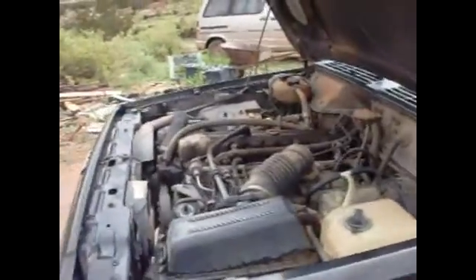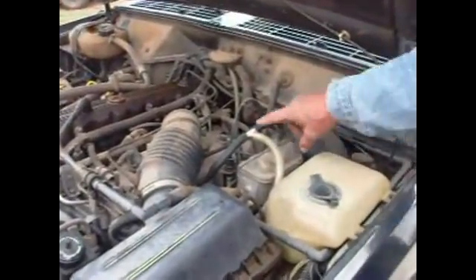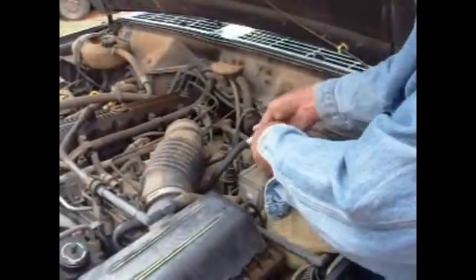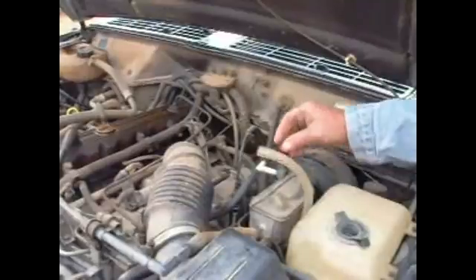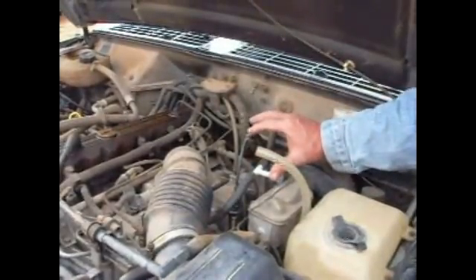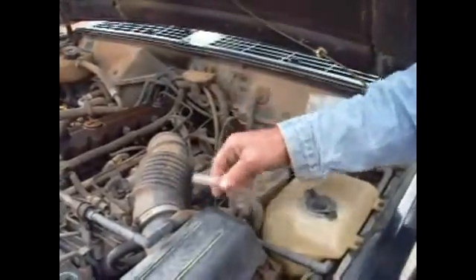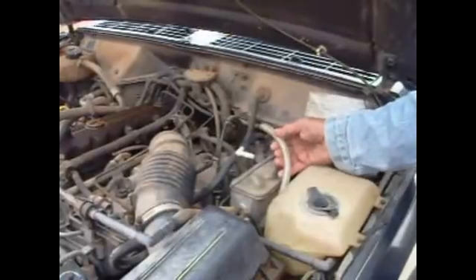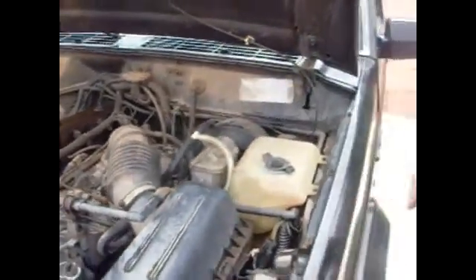Let's make this truck suck — let's go to the front, to the engine. This is the vacuum line for the vacuum boost brakes. I just use a regular vacuum tee that you buy at a parts store. If you hear the engine speed up, it's got a vacuum leak — like this line right here. Now it's idling fine. This hose goes down underneath and follows the routing along the frame to stay up out of the way, and it comes up in the bed of the truck. That's our vacuum hookup up here.